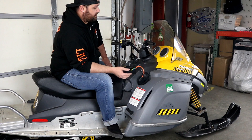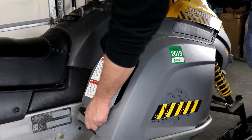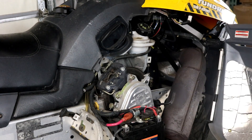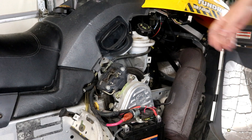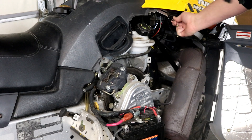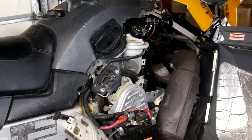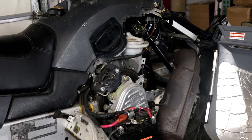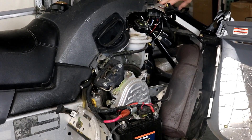So take a look — we're going to get the panels off and show you how to plug it in and how it works. All you need to do is open up your side panels. One strap here to get this out of the way — I've already done the same for the other side. Remove the hood strap, and I need to remove my connector for the instrument panel. Then I can lift up my hood and get it out of the way. Now we have easy access to the CDI box mounted right here on the frame rail.